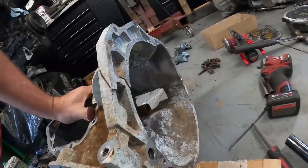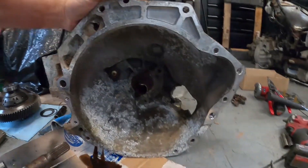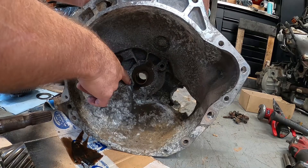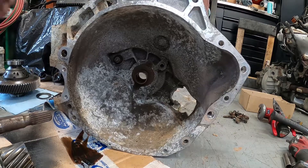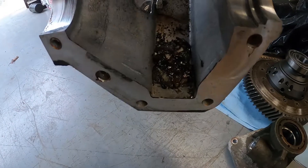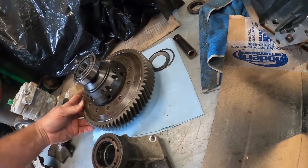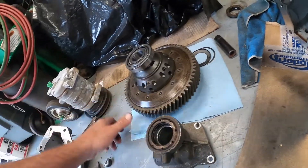We can definitely see how bad this housing was. I'm going to pull this stuff off, get it out of the way. There are two bolts here — we'll press this out, and this housing is pretty much garbage along with the diff cover. Right down there you can see some of the pieces that actually got inside. I'm going to inspect everything but everything still doesn't look bad — there's a little bit of dirt contaminants on this one that fell in.